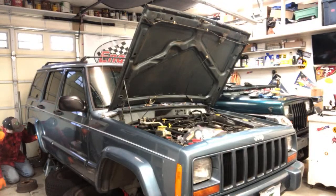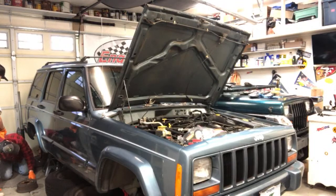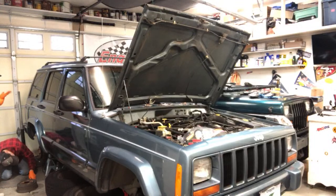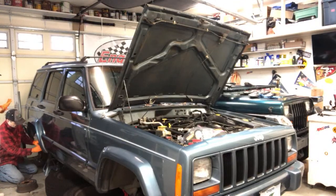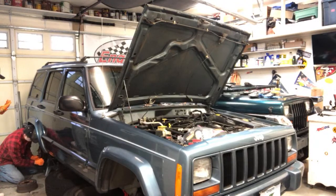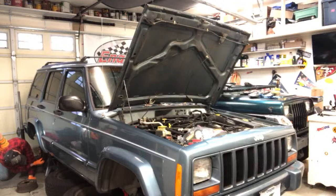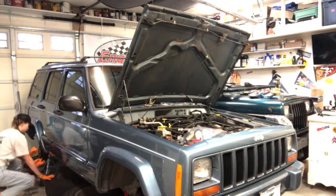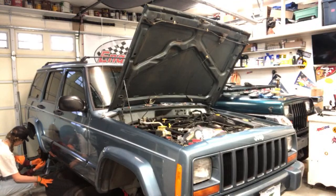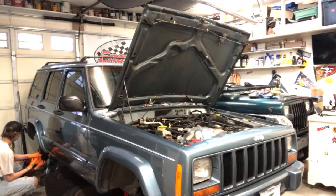So the wheel cylinders have pushed these pads out. So that's why it's giving us a hard time putting this drum back on. I don't think I can just do it by hand. Yeah, let me get some pliers and back off this a little bit. Oops, wrong way. This is the parking brake. So see, I loosened that a little bit. And did you see how the drum slid in? Yeah. So that's just kind of how it catches and sets itself.